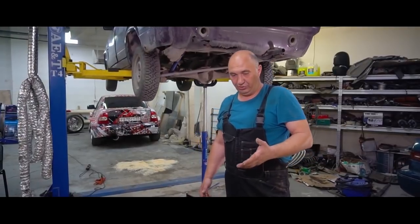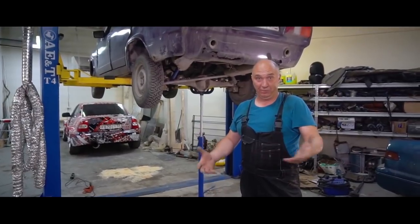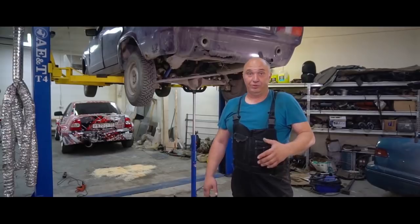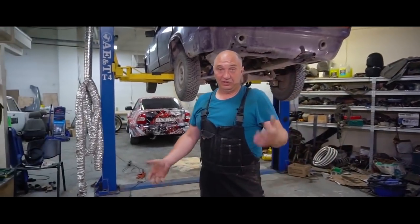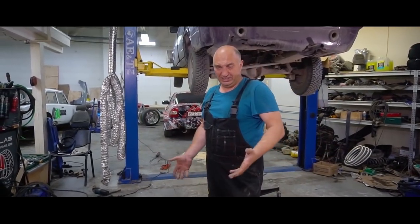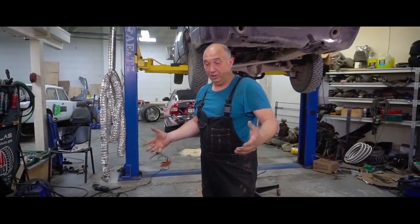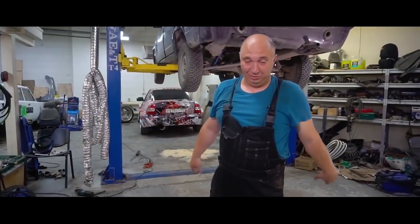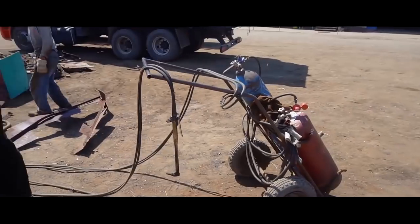Bending rebar is actually quite a challenge. I was actually just on the phone with some lathe operators. I mean, they do have some serious equipment at their disposal. But they want nothing to do with the whole thing. Can't imagine what they're afraid of. Which is why we're gonna take the rebar and put some heat into it. I mean, this isn't something you can easily bend by hand. That shouldn't be an issue, though, since we are dealing with carbon steel, which isn't adversely affected by heat, especially since we won't put a crazy amount of heat into them. Right, time to heat everything up. Throw it all in. Okay, let's do this.